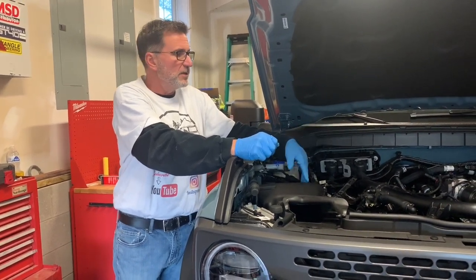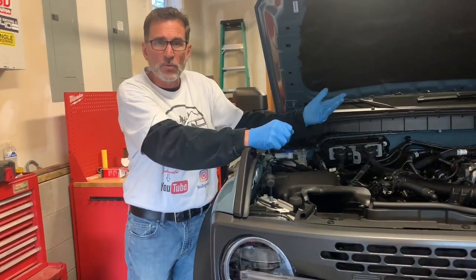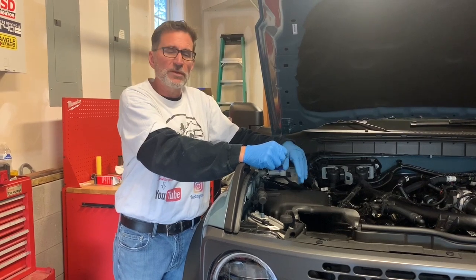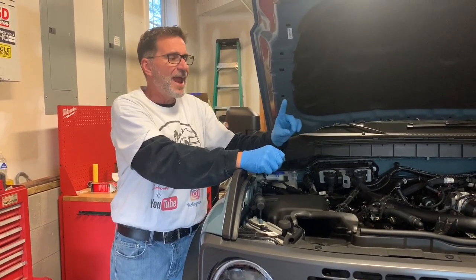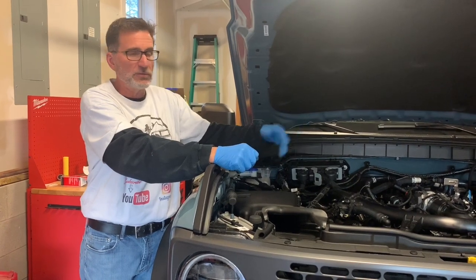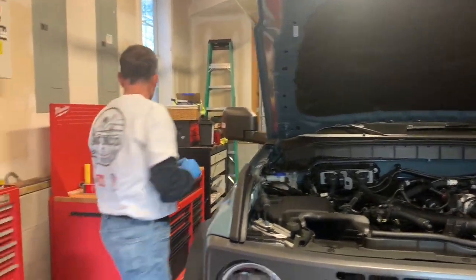So basically, we did find out when we opened the oil canister, we didn't get any measurable amount of oil out of the oil pan. So the myth there of taking it off was really, it's more of an opinion, I guess. So when we drained all of the oil out of the pan and then we took the oil canister off, we didn't get that rush. So it looks like it doesn't matter if you do that first or last, just as long as you change the filter, that's it. And let's look at one other thing, Becky.